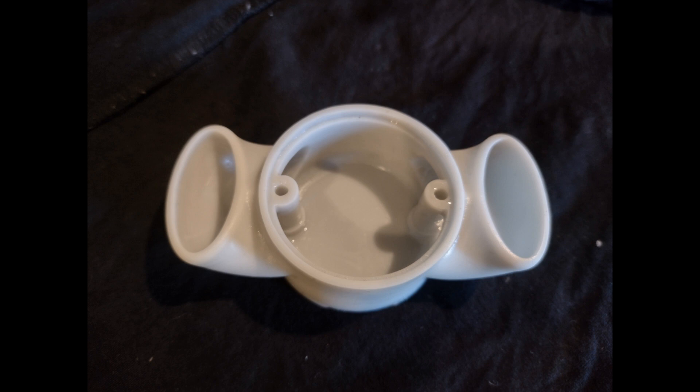In the meantime, we've redesigned the stock air filter cover. This design has two intakes on the left and right facing forward, so it's sort of like a ram air intake. We've dyno tested this and we didn't lose any power — it did run a little bit richer so you need to rejet, but I think it's a much safer idea than running no cleaner at all. We've put the STL files up on the motorbike forum and I'll try to add the link below, though there are still some restrictions on my account since it's fairly new.